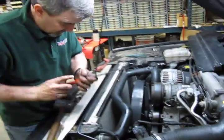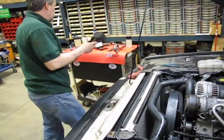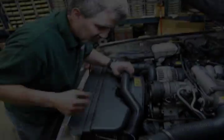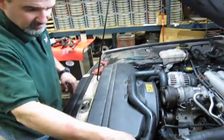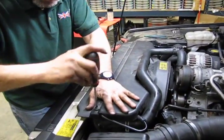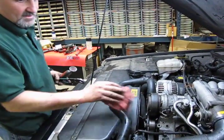Take our 36mm fan wrench. And then just a light tap to seat it. Set our shroud in place. Your vent line is going to line up with a slot on both sides. And just take your Phillips screwdriver and just get them started. Okay, so shroud is back on, locked down, fan on, belt on, all your lines are back on.